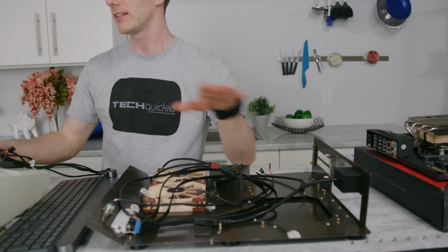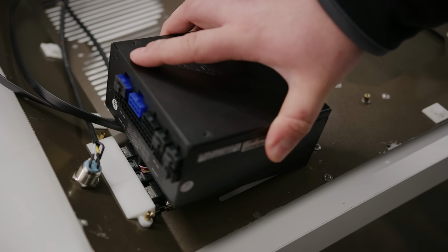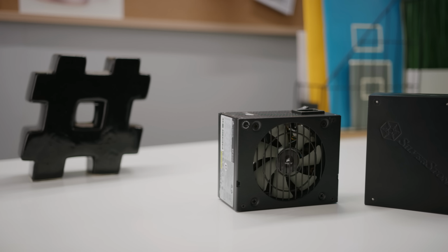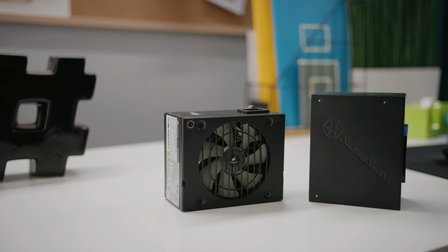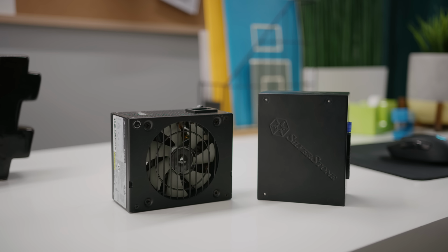Cooler clearance is another consideration for this case. It's got 82mm of total clearance, and yet another thing to keep in mind, it supports only SFX, not SFXL power supplies, meaning that the best that we can cram in there is a Corsair SF600 or a Silverstone SX600.